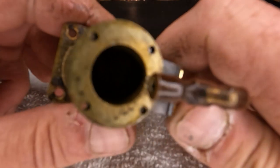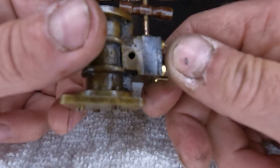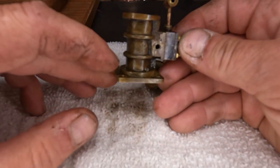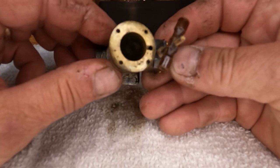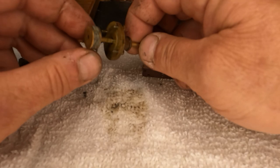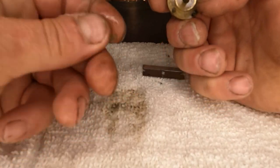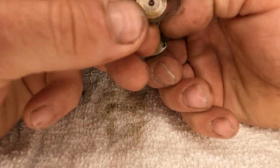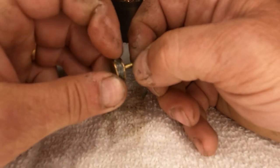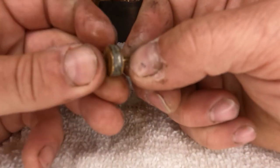Well, that's out of there. Let's look down — can you guys see inside? The bottom of this is bolted to this base, so there should be a gasket on the bottom side of this too. Let's get that out of the way. Let's look at our piston — some more of that silicone, a little brass piston, and this looks like some type of packing material. We may replace this with a silicone O-ring.